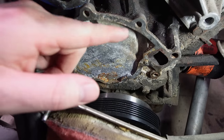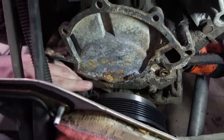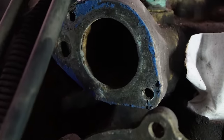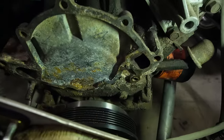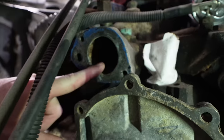Yeah. Well, me. So the water would come in through the neck here, and then go into the engine block and these two supports. Then up above here, we have the thermostat. Well, had. And up through the heads, then back out to the thermostat right here. So I guess our plan here is we need to make two ports to go on to the front of the block that our electric water pump can then pump into. So we'll get that to pump into here and come back out there with another port. So really two block off plates with elbows and stuff.